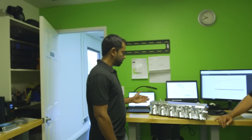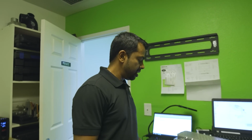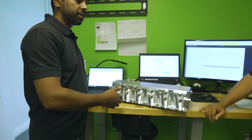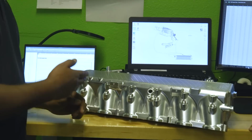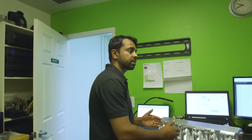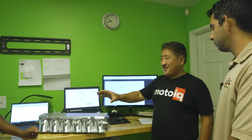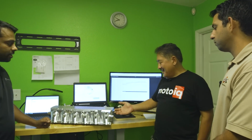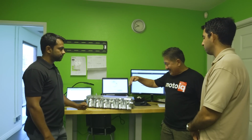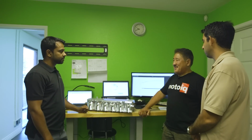It's going to be happier, and not only is that the positive effect of the manifold, but we've got the additional options for extra injection ports, for nitrous and for fuel. So the load on those systems is going to be less. So enthusiasts might not have to rely on those systems as much for their cooling. And it'll be really awesome too. You're going to have the cylinder cooling from the direct injection, and you're also going to have the additional charge air cooling from the regular conventional injectors too.